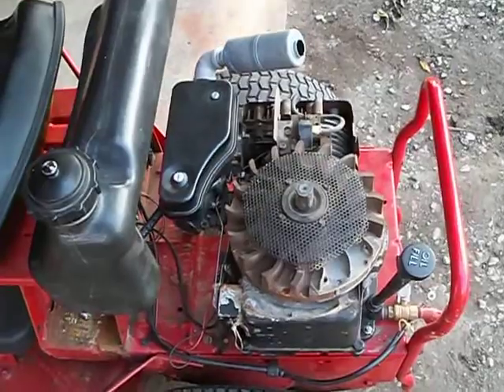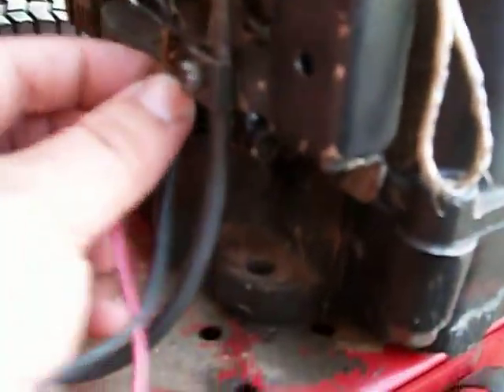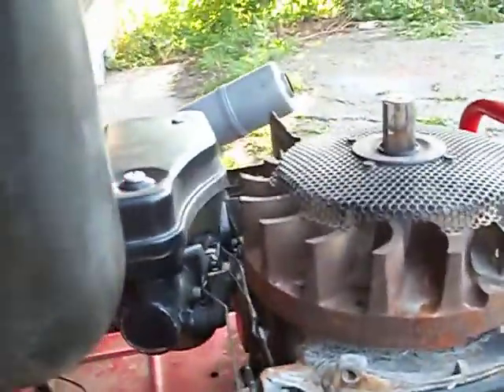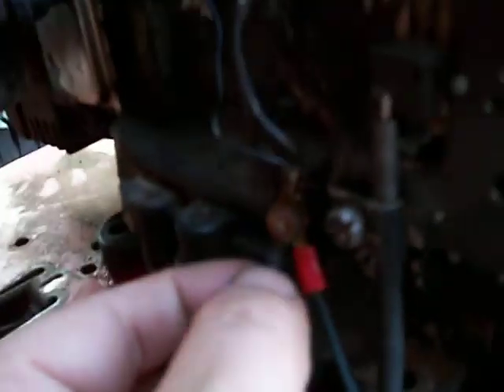Anyway, I have to show you this. What I'm doing now is trying to really kill it with a switch, so you can see that. I got one right off the magneto. Since this is a totally different engine, the engine runs great, I just got to choke it to kill it. I'm wanting to put a good kill switch on for him — he's a good buddy of mine and he's paying me to do it. You can see I got it rigged up here; this is the one coming off the magneto, this is the kill wire running up here.